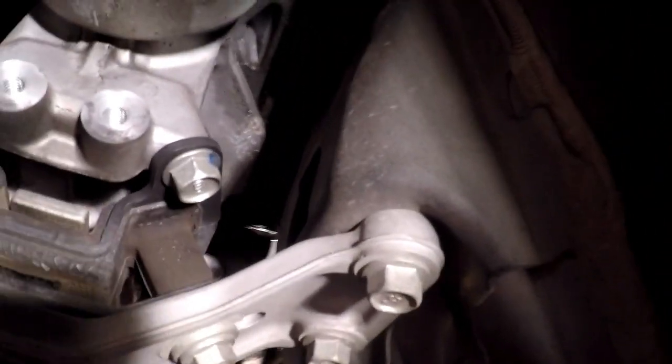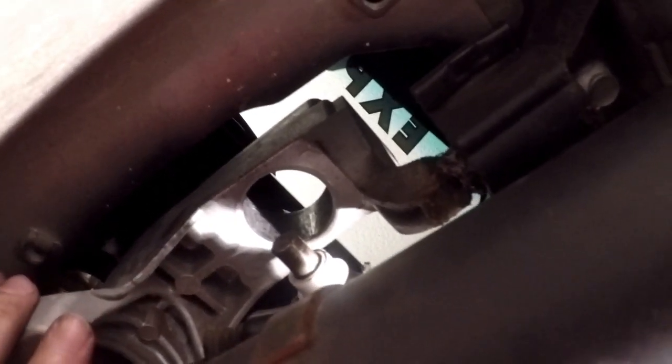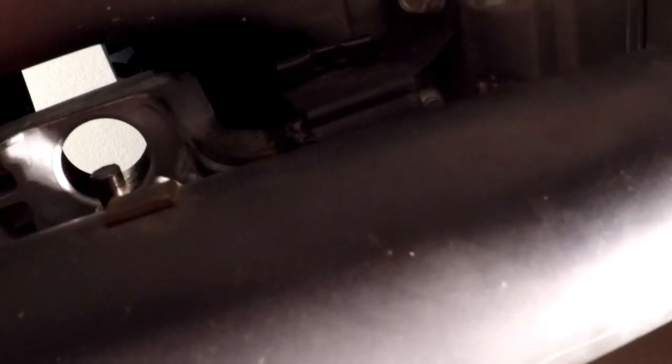So, one other little edit. As I was under here playing and looking at the car, I noticed that the housing that holds the shifter right here is actually going to stay on the transmission, because I'm an idiot, didn't know that. So I just got up in the car, took out 4 10mm bolts, and pulled the shifter up out of there, which is not what I did earlier in the video, but I've fixed it and taken it out of the car and set it aside on the workbench. So now all of this can come out, because everything you see here is actually on the transmission.